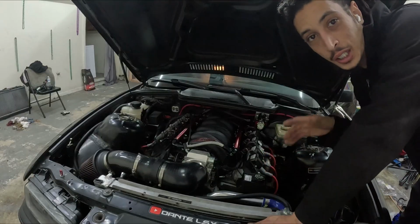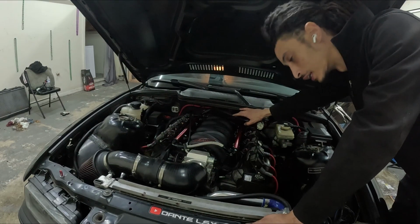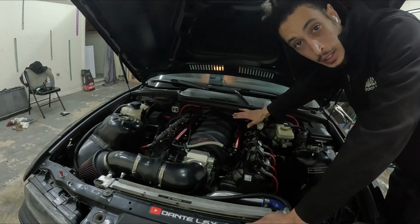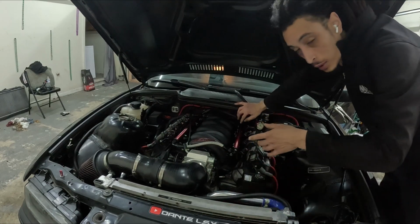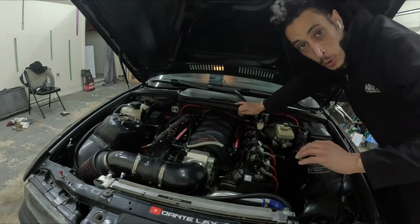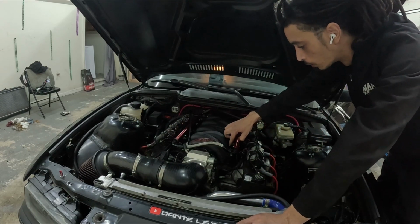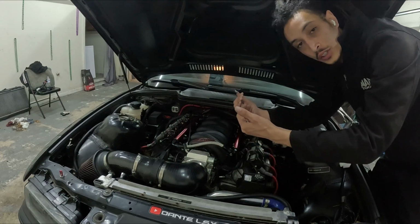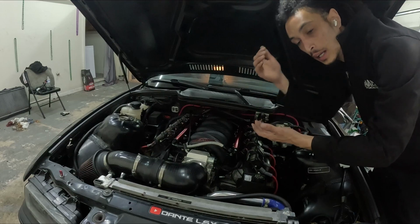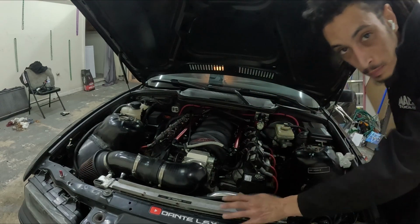All right, so I was having an issue with number 7. The number 7 injector was leaking. I got a little worried, thinking that I might have pinched the O-ring, but I did lube everything up how I was supposed to. But it wasn't that. At least I primed it once and it didn't leak. I'm gonna prime it a few more times and see. But the brackets for the rails are slotted, so I just had to shift the back slot over a little bit, and it got the injector to seat all the way. So I think that took care of the problem.